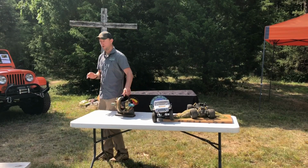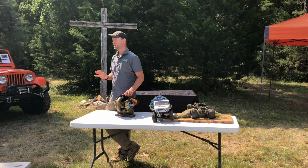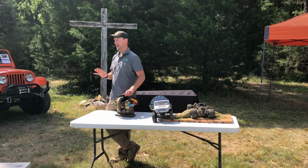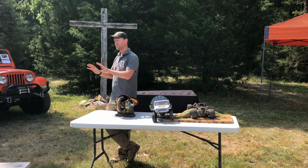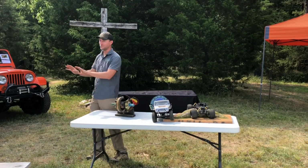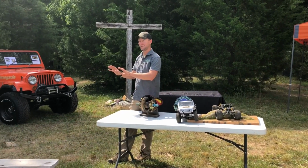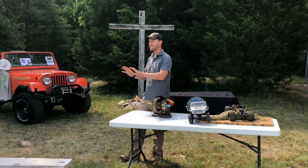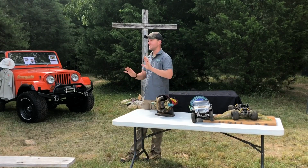So our philosophy is, and this comes from some experience, I don't want to replace a clutch off-road. So that's why we tend to get away from it and move over. Scott, my mentor and the trainer we were talking about earlier, he always said, no touchy the clutchy, right? He'd tell the military guys, no touchy the clutchy, because I don't want to replace a clutch off-road, and that's a wearable item.